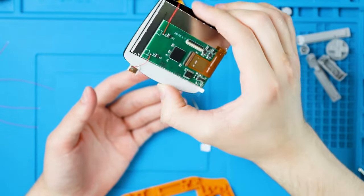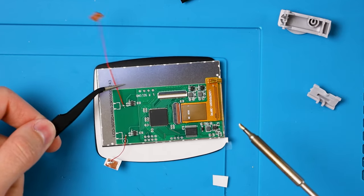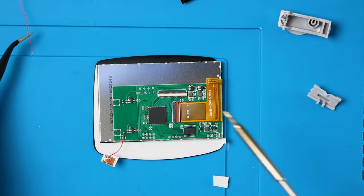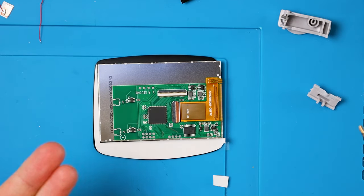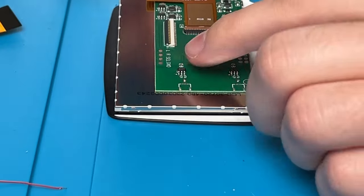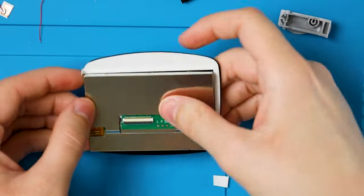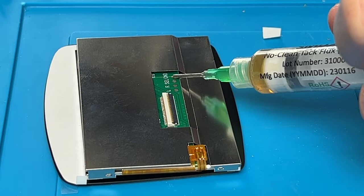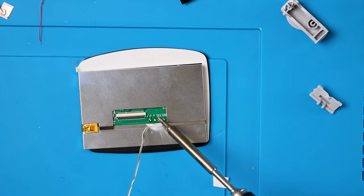Hopefully we're still working here. I really don't want these stupid touchpads. So we're going to take our tweezers and soldering iron and remove these by desoldering both points. Just touch the iron to this point here and pull the touchpad away while it's heated. You really shouldn't be soldering on top of a screen like this, but they stuck this board down to it, so it's our only option. Now that we have those removed, I'm going to put this back on since our solder points are accessible through this hole. Just push it back down and the clip should come back to life.